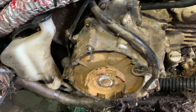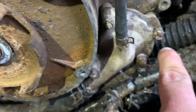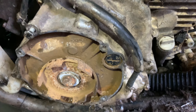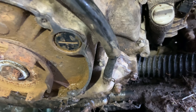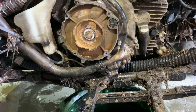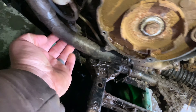We got it all back together — this was a pain in the rear end. The biggest problem is that gasket did not want to go. Not only that, you have to take the water pump off — four or five bolts, squeeze the hoses and pull them off, get the water pump out of the way to get the last bolt. The propeller looks like a turbocharger — you gotta twist it just right when you put it on, otherwise it's not lined up. I accidentally spun it when it was off, so it was interesting. The gasket was the worst part, I'm telling you.